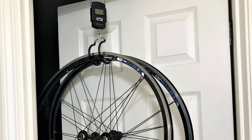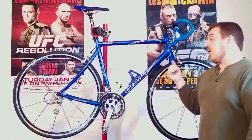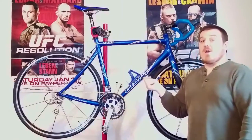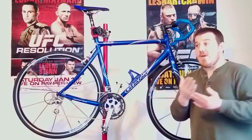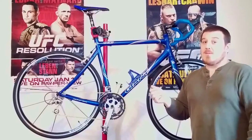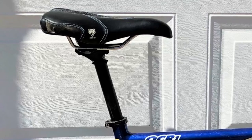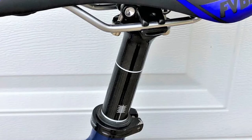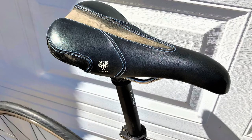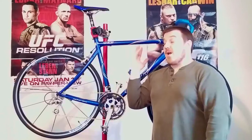The 1996 Giant I did had wheels that were way heavier. At 2,000 grams these are solid training wheels, and in the future you could drop down to a wheelset around 1,550 grams and lose roughly a pound. As for weight savings elsewhere, this was supposed to come with a carbon seat post - somebody had put an aluminum one on here. I put a carbon post on, dropped a ton of weight. Carbon seat posts are about $20 and it's pretty common for someone to pinch the carbon post before selling a bike. I also changed out the saddle - the WTB that was on it is more of a training saddle, so that's going to be mine now.